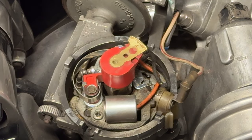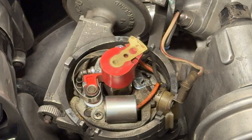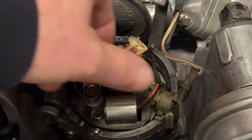You can now see we've got a gap in the points. I haven't got my feeler gauges because they're in the boot of the green car, and I can't get to them — the red car's parked next to it, the silver car's parked next to that. The boot release on the green one is internal and I can't get in to retrieve them. We'll take a guess at that, but it looks about right. The issue was this little lug here was bent over too much, not allowing a proper gap.